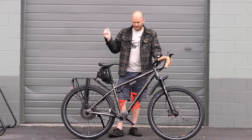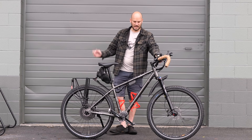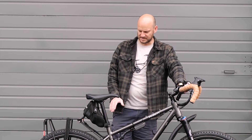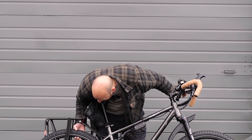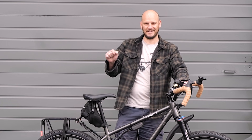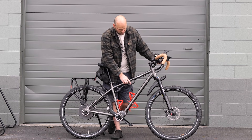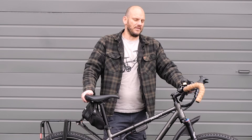You can see 30 miles an hour, and again this is stock — we didn't do any changes, straight out of the box, no changes to the controller or the motor. 30 miles an hour — that's plenty, that's more than legal, it's slightly above the legal limit. For hill climbing, I think it's the wheel ratio — the diameter. These are 700C wheels, and with big wheels the circumference is really big, that's where a hub motor is going to kind of pay the price. I'm sure if Grin is watching they'd tell me to change the settings to get more power — I'm sure you could get a little more power through this thing because this is a very powerful controller — but straight stock out of the box, 30 miles an hour and decent hill climbing.